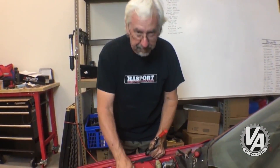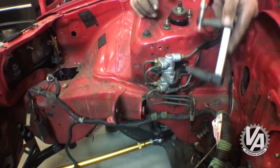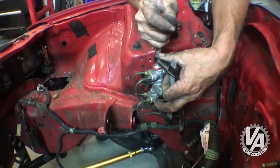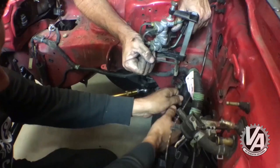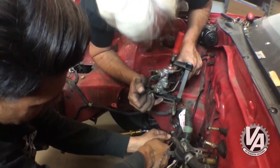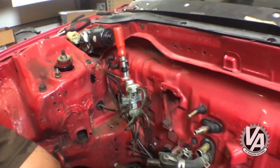Part of this procedure for getting this off: there are actually some springs in there that help maintain pressure in the rear braking system when you're coming off the brakes so the car stays more stable. When we take this black bracket off, this is going to try and separate. So one of the things we do is put a clamp on there to clamp it together, so as we take the screws out to move the bracket around, it doesn't try to separate. The next thing we're going to do is bend the brake proportioning valve over up against the firewall. I have to be real careful not to kink any of the lines, because if we kink any of them, we have to replace them. All we want to do is flip this bracket over so we can put it up against the firewall for a clean install.